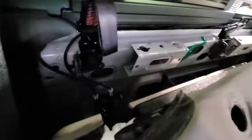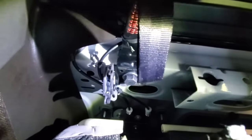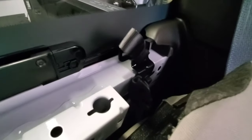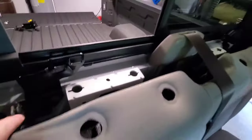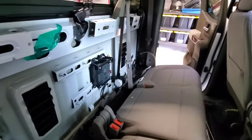There are three of them. This side is the easiest because you can actually kind of see it when you're in here. Reach down and hit this right here with your tool, lift up, and as you're lifting up pull the seat forward — you'll hear it unlatch. There's one there and one there. When you get all three of those, the whole seat back slides forward and you're ready to pull it out.